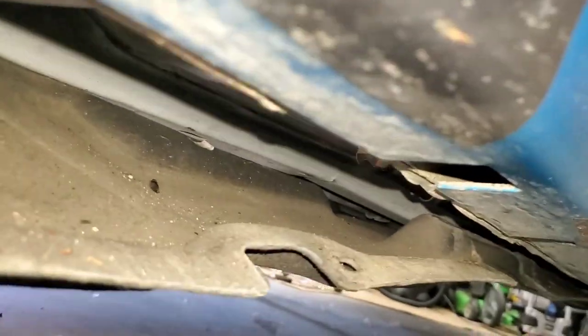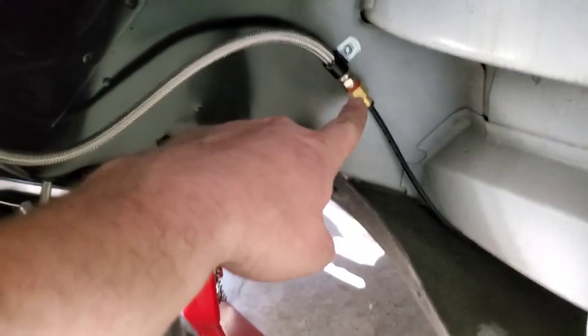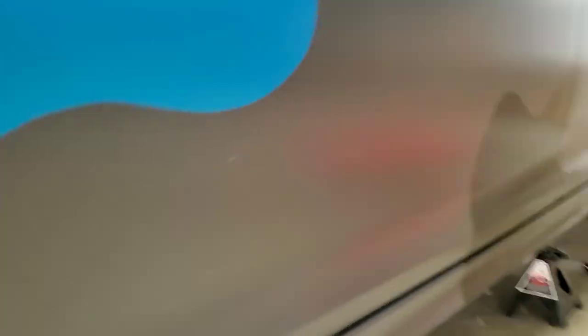There was a push pin right in here but the rest were 10 millimeters — and this is going to be perfect. You can see there's a line already right there, so I'm just going to run it down that channel all the way down. We've got the leader hose and the line clamp. That line is now going all the way under and tucked right in there down that channel, which works super well. We're going to come out right here and zip tie it for the time being, tucked up under the filler neck.